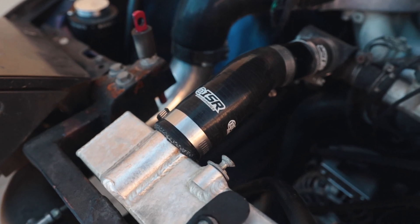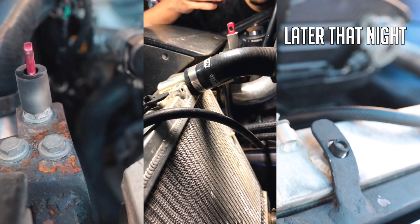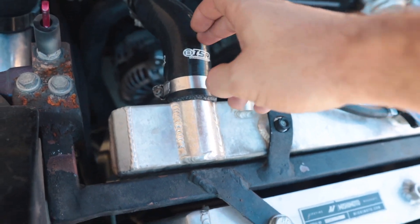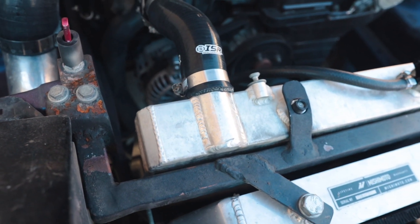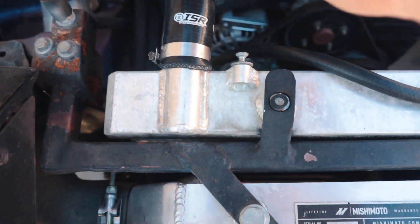It's smoking right now. Looking at the bottom of the hose, it's completely dry — there is some residue on there and residue on the fins all the way down, but I don't see any actively wet spot. I'm thinking it's the residue on the radiator from when it was leaking before. It was leaking at one point, I originally tightened the clamp, and we tightened it again today and moved the hose forward more.